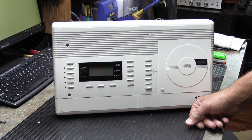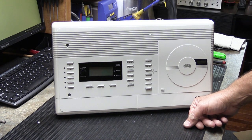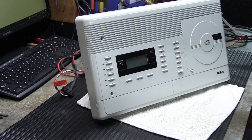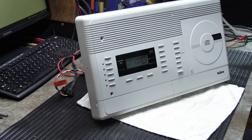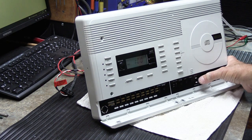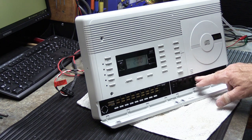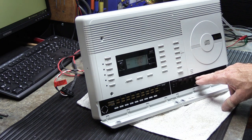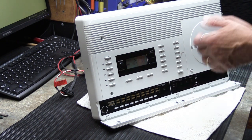I was willing to roll the dice and take a chance on it for the amount I paid, because it has some usefulness to us. I've got it hooked up to my two bench power supplies, which take the place of Nutone 801T transformers, and to a makeshift antenna. Let's fire it up and see what happens — smoke and flames, or it just turns on. When you power up a 4406 and get that sort of half-volume beat tone, that's usually a good sign. And here we have a flashing one o'clock. Can we set the clock? It's actually 2:16 in the afternoon — and yes, we can set the clock. That's a good sign.